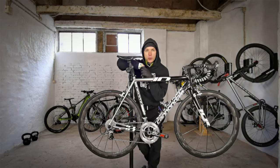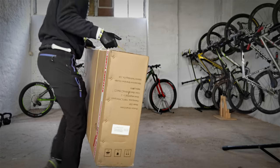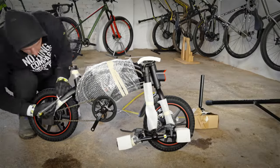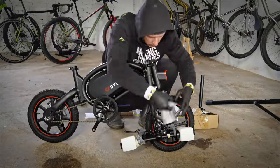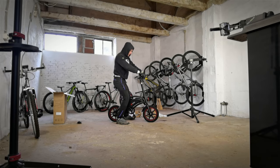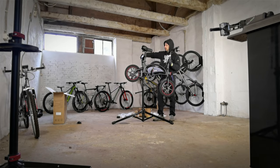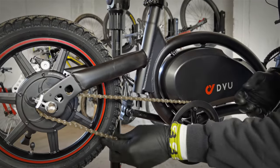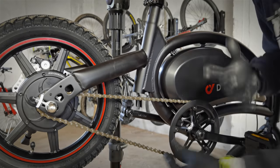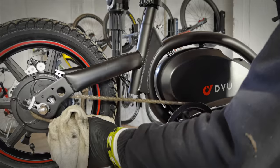Now we're going to do some unboxing of a little sweet e-bike that will work at the e-bike rental center, and I'll show you what I do with a new chain. Most new chains are a little too sticky — they have too much oil or some kind of lubrication on the outside, so simply wiping it off doesn't really work. This is why I'm going to use the degreaser. Now the chain will be more dirt-proof.